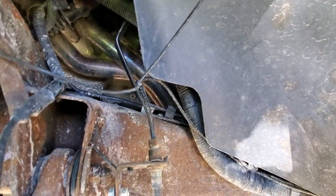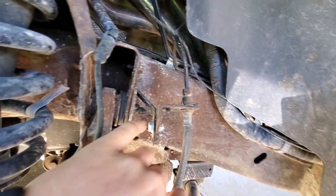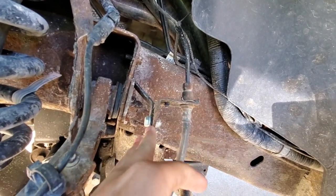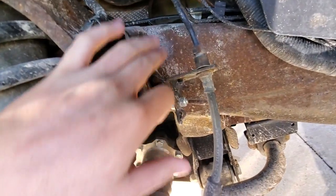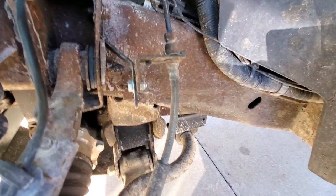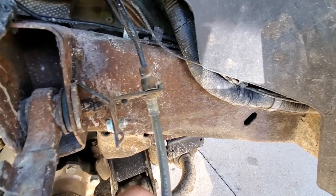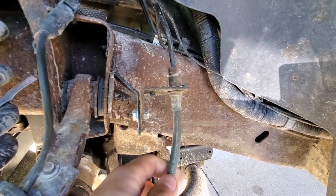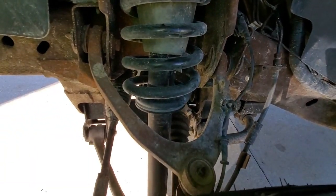should probably cut that. That's for my wheel well lights. Runs up there. I have to remount them still. But for the brake line, they don't give you a longer brake line to attach into it. They give you a mount that you bolt up to stock location, bolt the stock mount to the new mount, and basically pull on your brake line until it's in the correct location. Mine get tight, but not too tight. They get kind of taut, but they don't get so tight that you have to worry about it breaking on you.